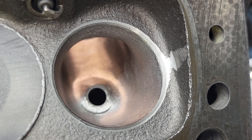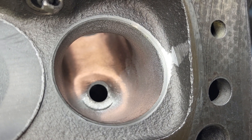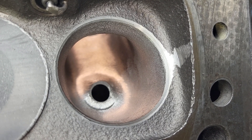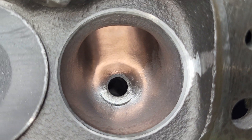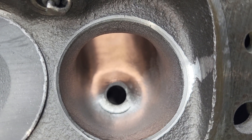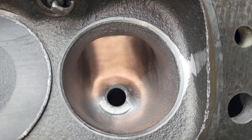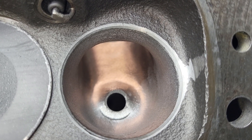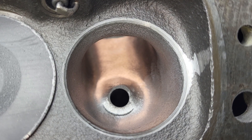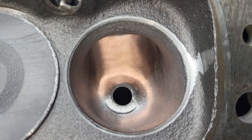So let's take a look at the airspeeds and the flows and see what we got. To be honest, I think I'm about done with this — I kind of got to where I wanted to be. I really don't like the way this looks at this point. It basically looks like it has almost no throw; it goes right from the seat on in. I know there are guys that don't have nearly that much overhang on the short side. As of right now, we're 1.416 side to side and 1.425 up and down.